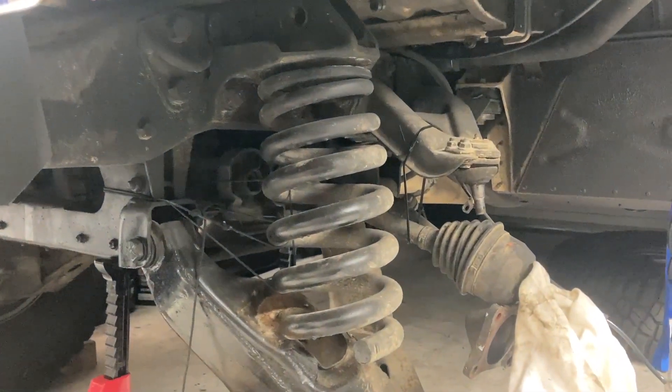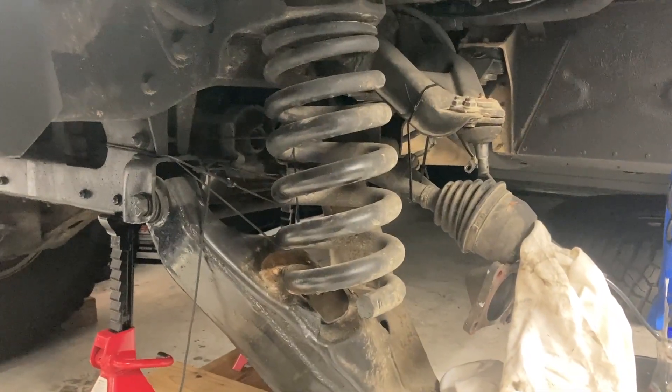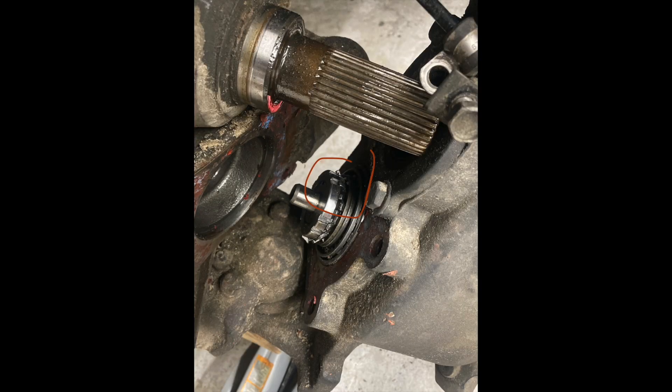Now I've got to fit up the new spring on the seats. The part that's circled here is the retainer clip for the hub nut or axle nut. There are only a couple teeth that engage, but mine were there. I think this is pretty important - make sure you've got that engaged before you start seeing any kind of speeds.